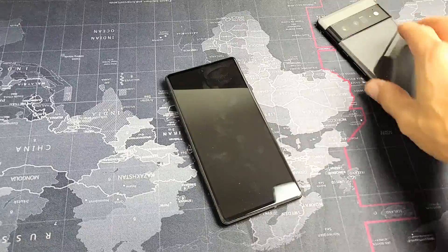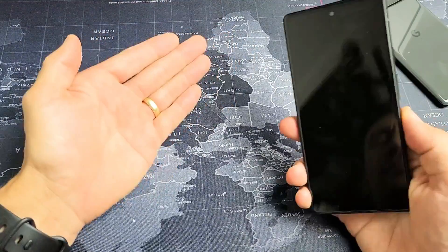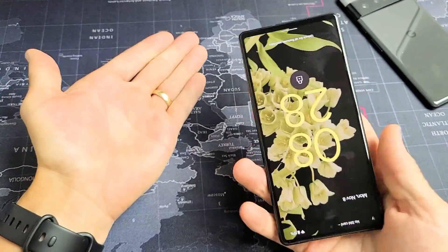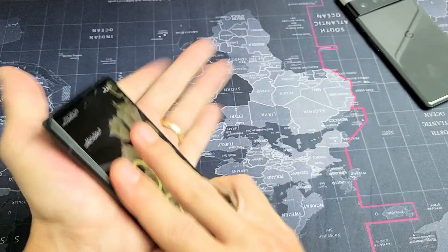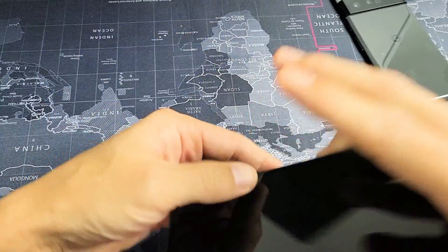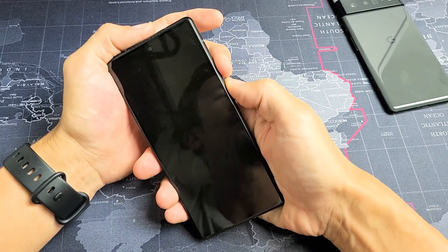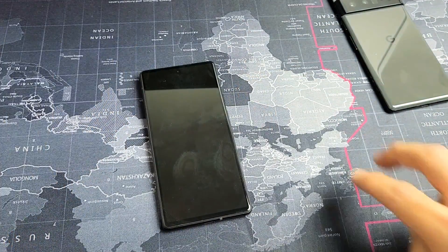The next possible solution is what I call the smack method — same premise as the tapping and the massage. You may have something slightly dislodged. Hold your palm out and smack the screen and also smack the back, including the bottom of the screen and the back bottom. If you're lucky, it'll be out of the boot loop. If it's still in the boot loop, do the two-key combination again: power button, volume up, press and hold both buttons for 20 seconds, let go, and hopefully you are back up and running.